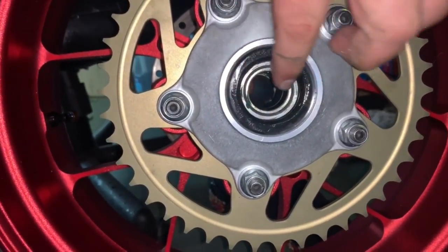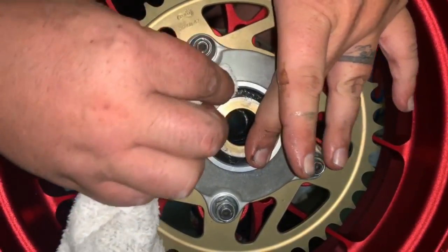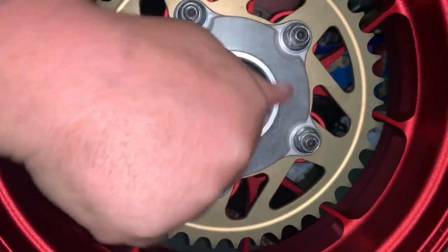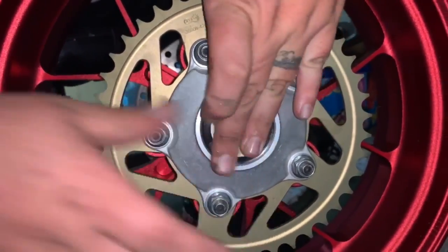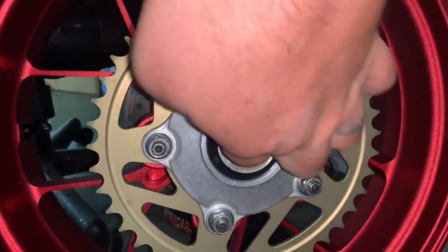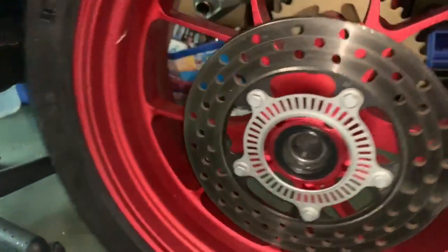like so. And then we take our spacer that's already greased up, put it in like there. Take your clean rag and just wipe off any heavy excess of the grease on the seal. And your seal's pressed in, nice and smooth. And you'll feel, you turn it a few times and it kind of picks up that grease in that channel. And the spacer actually moves just like a bearing, nice and smooth. And then one more dab of grease, just to line the inner side here, so you don't have to put such a thick layer on the axle. So the outside's done, we'll flip it around.